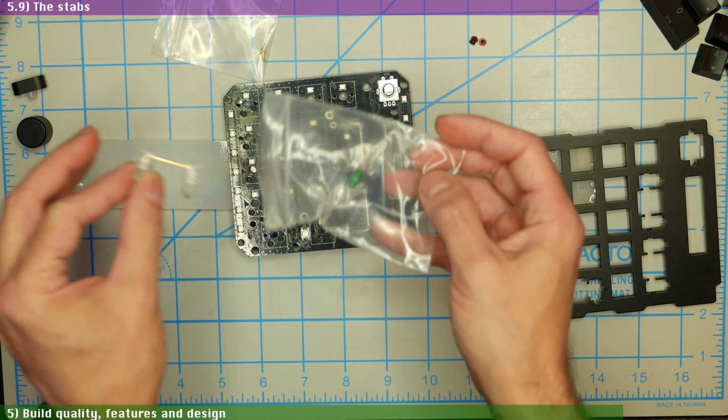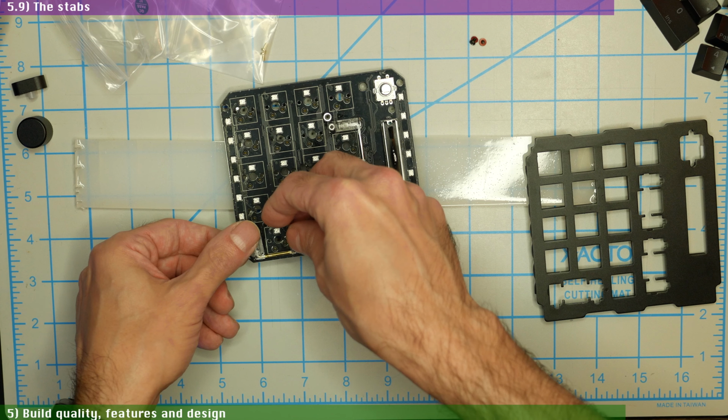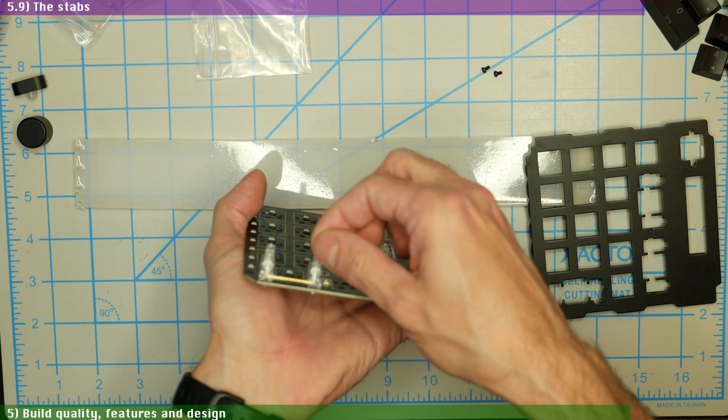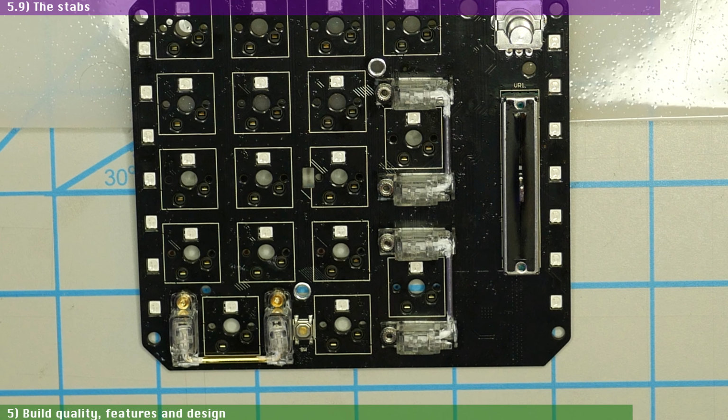So I ended up replacing the sticking stabilizers with a KBD Fans Clear set I had here, a leftover from my KBD67 Lite, that worked perfectly fine in that position with any keycap. Having said that, the good thing of the GMMK line is that they are relatively easy to open and replace their stabs, and doing so will not void your warranty.